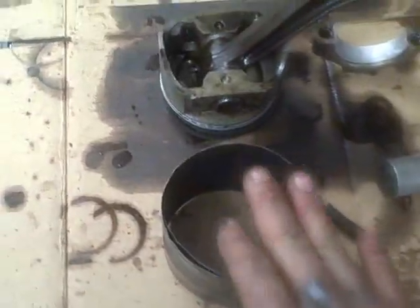We're all ready to drop our pistons in. I've got the ring compressor here and the pistons are all ringed. You can see I've put the bearings in each one of these. The procedure I use — it can be a little messy but it's always worked really well for me. When Phil and I laid out all the pistons on the table, we laid them out so we'd know where they go.